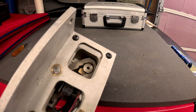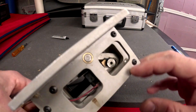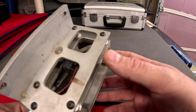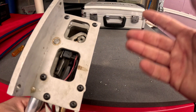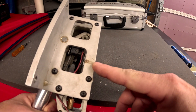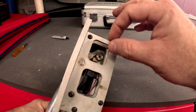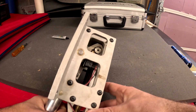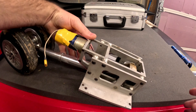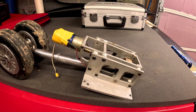My assumption is these steel plates, which bolt to this trunnion piece, have basically opened up over time — or due to the last crash, the gear may have taken a pretty hard hit on the ground, since this is the one that was broken free from the fuselage. So that slot has just opened up a little bit, allowing that significant amount of play. That's pretty much the quick rundown of the gear — it's the same on the other side and on the nose gear.